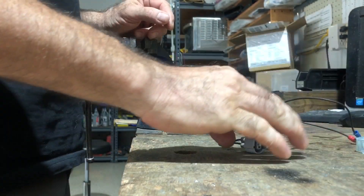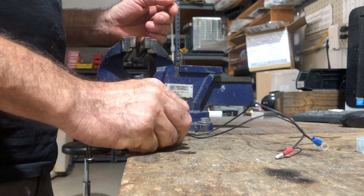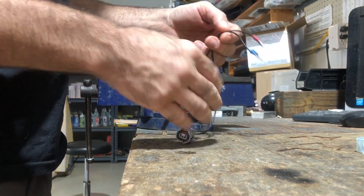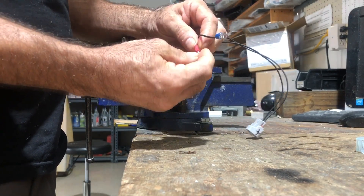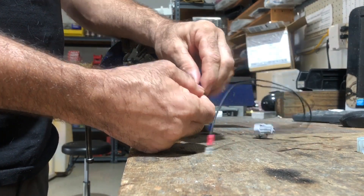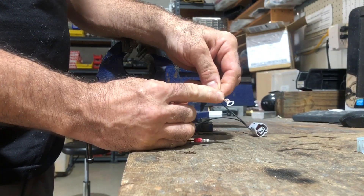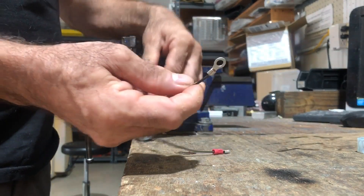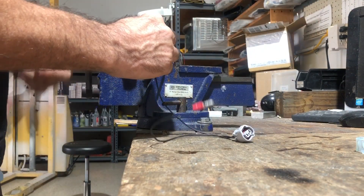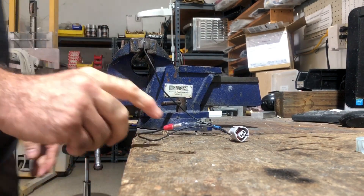You're probably going to have to get all that wiring redone because this is not airworthy. Here's the connector we sent you — that's airworthy, it has proper crimps. Here are some automotive connectors with improper crimps. Aviation ones have a long metal barrel that goes on top and puts the proper crimp on the terminal. This one is just a flat crimp, and if the rest of the airplane is done this way, you won't be safe flying over the mountains and glaciers.